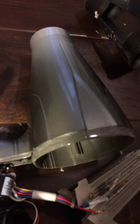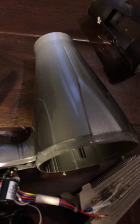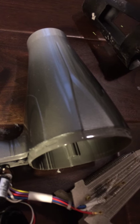They have a little spot here where it looks like they could have put in an option. I could probably install a small switch there. The coolest thing would be to put some kind of digital rotary switch in here - a spin wheel - so you could spin this thing up and down in speed, giving you a continuously variable speed on this hair dryer. Because the low setting on this thing is really fierce - as you can see from my previous video, it puts out a lot of air. The good thing about that is it's going to dry your hair really fast.